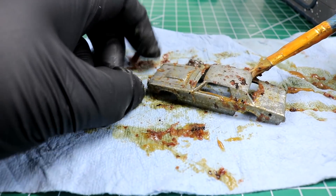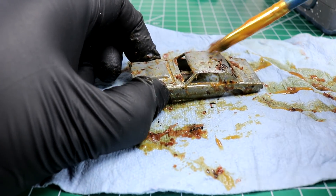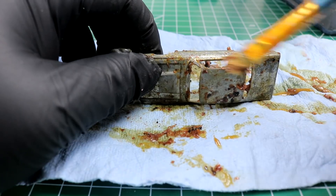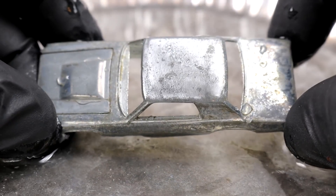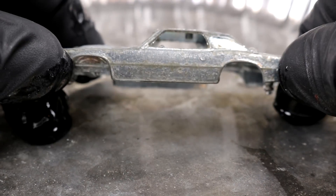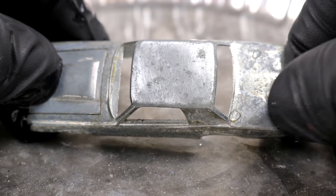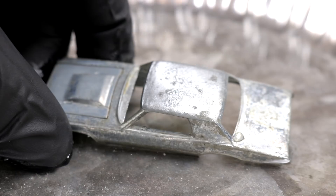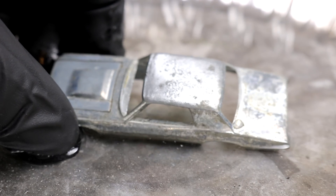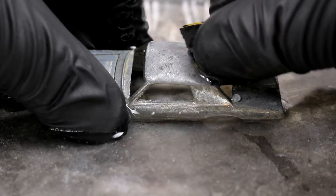I've got the whole body stripped here. I'm going to take this to the sink, give it a bath with some hot water and a wire brush to try to clean out all the little specks of paint I may have missed. Here's the T-bird — it's looking pretty rough. I've got it in the wet sanding tub. First thing I want to do is give this thing a wet sand down to 400 and see what shape our zinc is in. Looks pretty rough. If we do have to zinc plate this car, we're going to have to sand it anyway just to get it smooth so the zinc has got a nice even layer to bond to.